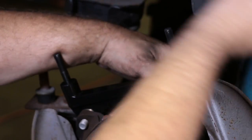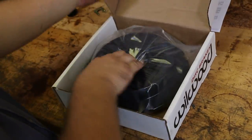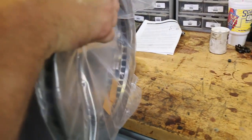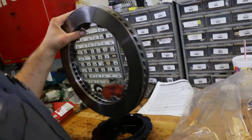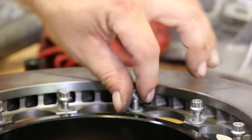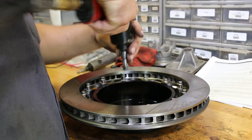And the way to do that is by using good brake hardware, not only at the wheels, but also under the hood. As far as installing the Wilwood disc brake kit, it's actually a little easier than a lot of disc brake swaps because you're not changing a whole lot — all the stuff bolts to the stock brackets because it was already designed for disc brakes. The most difficult part is we used two-piece rotors on this car, which means you have to bolt them together and safety wire all the bolts. Bolts are torqued, Loctited, and then safety wired because they're drilled for that.